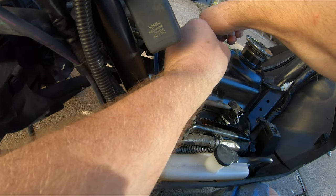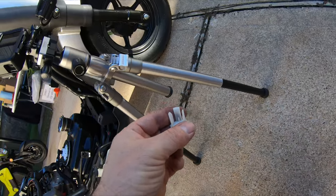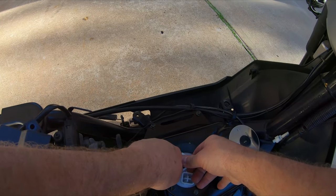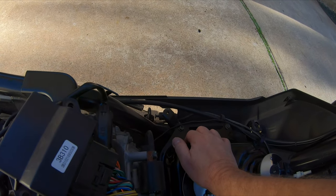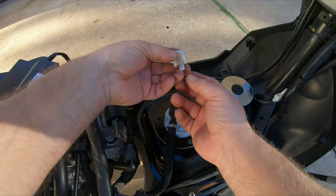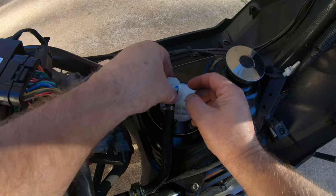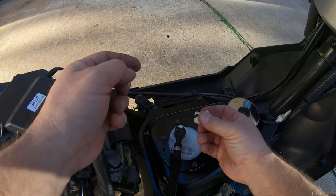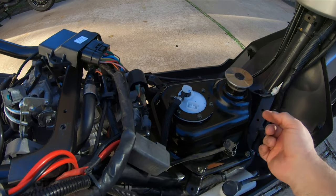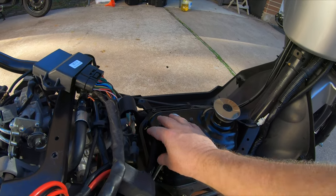You've got to get it rotated just right and press down and in, and it unlocks and relocks somehow. This little guy goes in over the top and just keeps it from popping out. Just push — yep, that's it. It has a very tight O-ring in there. This is a three-legged monkey so the open side faces your hose side of things and it just slots in, and then that little catch locks it over the top. Clickety-doo-dah. So now the fuel line coming out of the pump is attached, and this is the electrical for the assembly — fuel pump and fuel level sender.